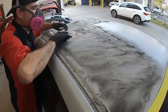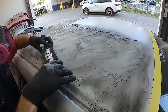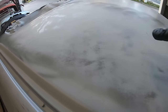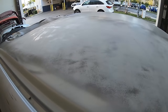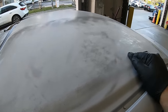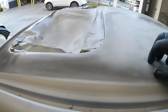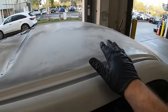This is probably the hard part of the job, but it's really what's going to show the end result — a nice smooth finish after it's painted. After a quick pass, what we're seeing is guide coat. These are low spots, but not necessarily a dent — just spots that still need a little bit of sanding. We'll pretty much continue sanding until we don't have any of these low spots. Now if we were sanding and one was very, very low, that would be the indication that we need to fill it. But I think we did a pretty good job with our bodywork, so we should get away with just blocking it out.